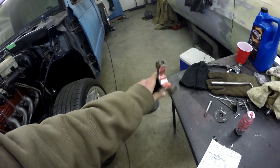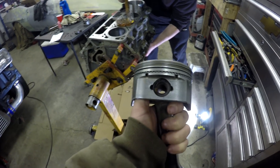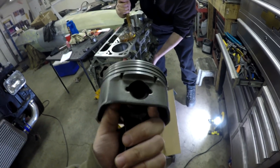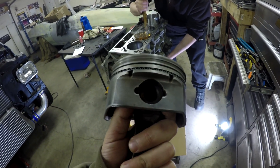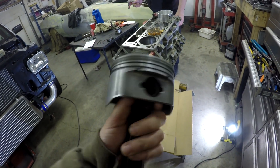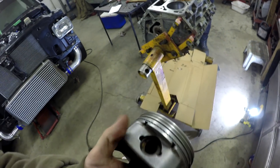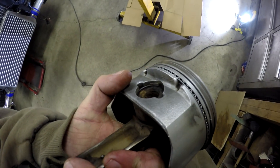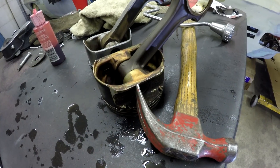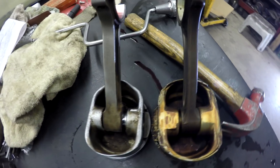The gen 3 rod has a curved edge on one side, so that's one easy way — from the bottom with the windage tray off — to tell them apart. The other difference between gen 3 and gen 4 rods is the wrist pins. Gen 3 rods came with pressed-in wrist pins, and some gen 4 rods came with press pins too, but by 2005 they had floating pins in them. You can tell the difference — there's a little ring in there holding in the wrist pin. Here's a dirty gen 3 rod that came out of the 6-liter for comparison.